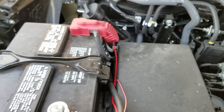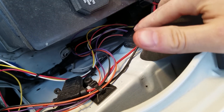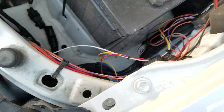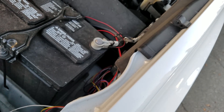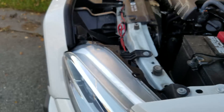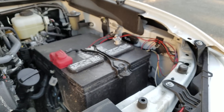I didn't need any other power switches. They're hardwired to the battery, positive and negative, and I still have a fuse inline. Basically it's just using that controller to sense when there's positive voltage. The way it comes from the factory it gives you three options — a ground, nothing, or positive 12 volts — but you can kind of fake it out to do a setting for voltage in either of those three to cycle between the different power levels. You just got to get a little creative with how you want to tap into the main lights. If anyone has any questions on that, let me know and I'll show you what I did.